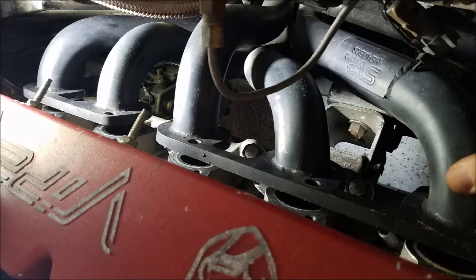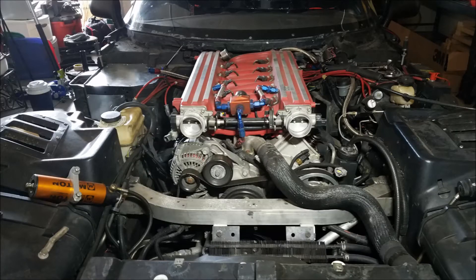The rated horsepower from the factory was 450 at the crank, and it made 425 at the wheels, so something was obviously working. I did end up replacing the thermostat as well — that big hose leads right to under there, and you have to remove the intake to replace the thermostat in this car. The intake is a giant pain in the butt because the bolts are actually under the injectors, and you can easily lose the tiny little bolts in there — star type double hex, the real fiddly ones.